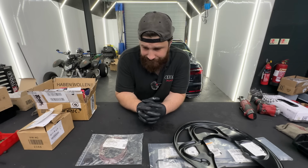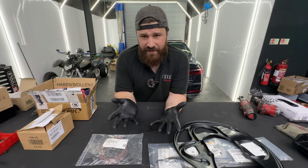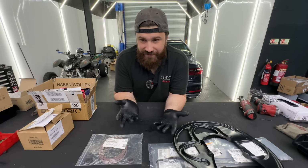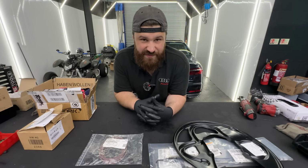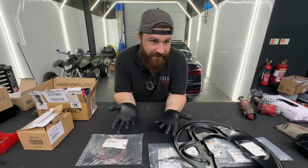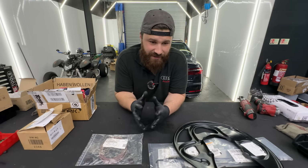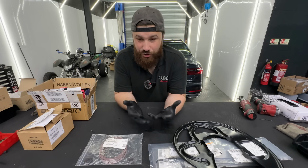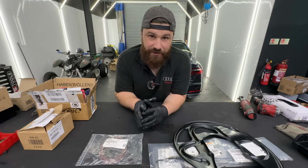So that's the plan. But the difference between steelies and carbon ceramics, well, if you really want to drive the car daily and you're just going to be stuck in traffic, you don't really need carbon ceramic brakes. However, I do have a plan to go on a trip to Europe. I do want to use the car as a 1000 BHP car, so I do want to accelerate and brake several times, which I think the steelies will probably not take very well because the heat absorbing and everything will be quite high, and it's a short-term thing, especially when we're doubling the BHP. So I think the carbon ceramics will be a good idea to put on there.